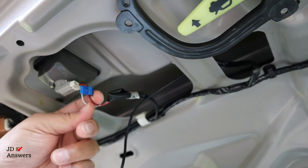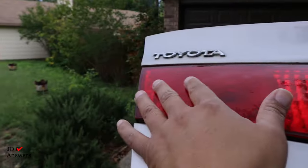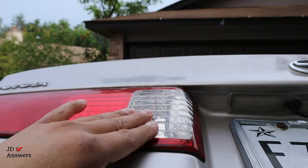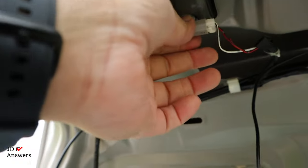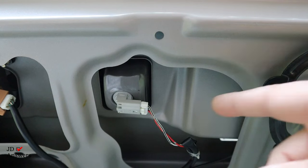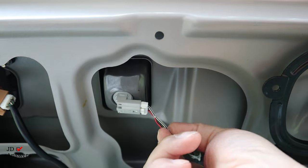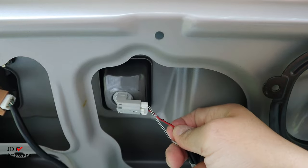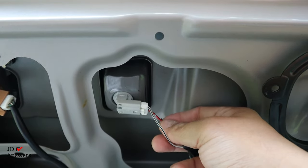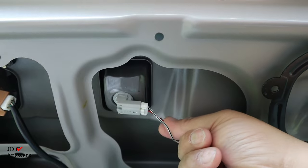Next is when we actually start working on the red cable — the red wire — so we can make this a backup camera. This is the tail light we're going to use — we want the backup light. Open the trunk and you can see exactly which wire harness it is. You see the wires: one is white and black and the other is red and black. Usually the one in black is your ground — that's not the one you want. You always want the one with the color — anything like red, yellow, or green — because the other one is going to be your ground.